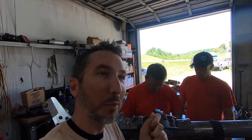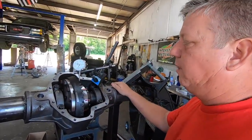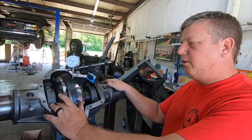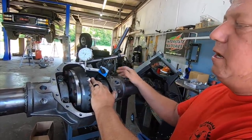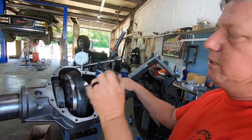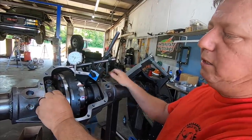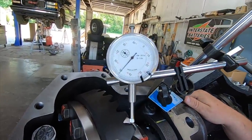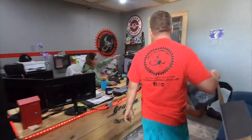He's got the numbers down to a science. We're going to run the pattern one time, see if we've got the right pinion shims behind the pinion. If it is, we'll pull it off, put the permanent race inside, torque it down, put the seal on, then pull this out and put dummy shims beside the carrier bearings. We'll take the bearings back off, put the correct shims underneath, then run the pinion one more time. I do want to get that down to like seven. Going on a mouse hunt - this is going to be so much fun.